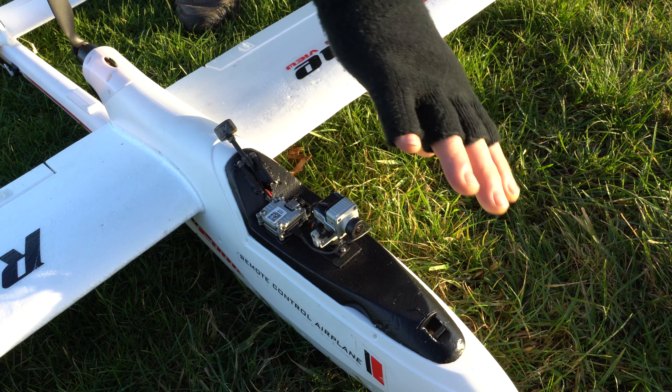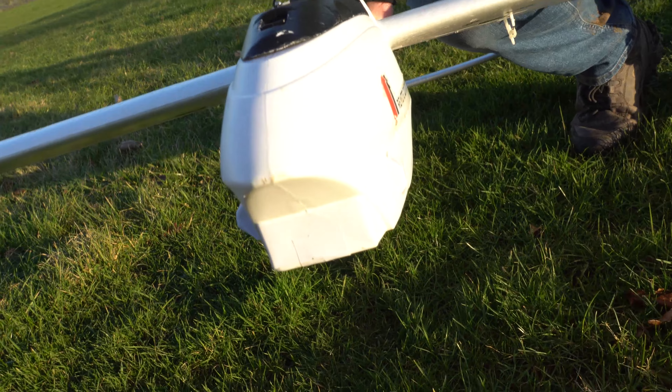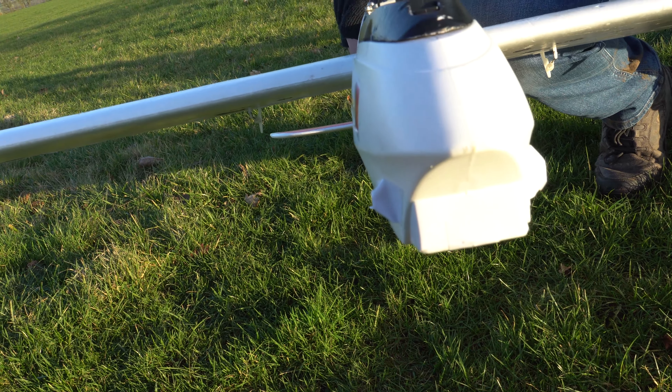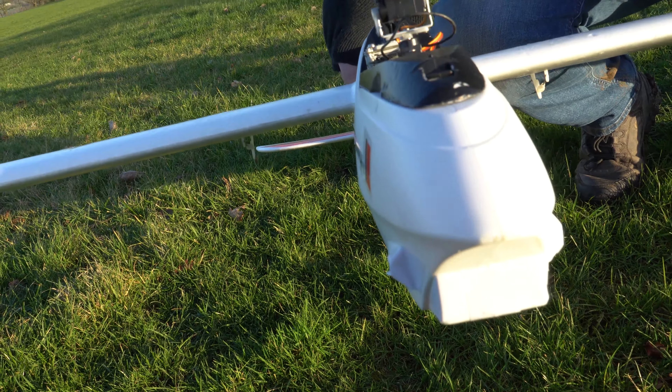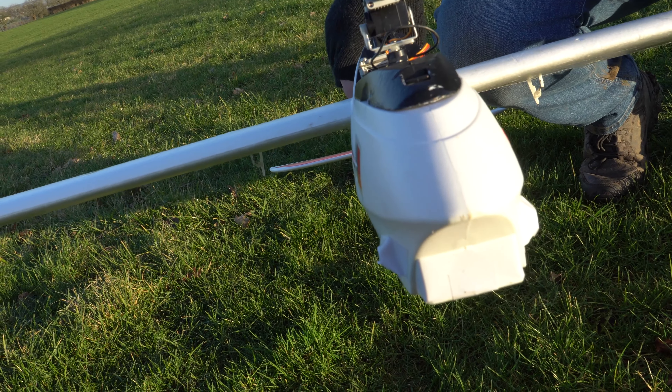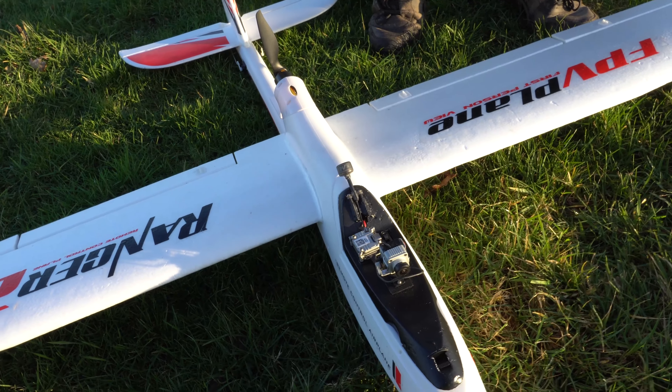I love the switch that you added so you can switch the Vista on and off so it doesn't overheat - just a bit of aggro. You sprayed this black with some Halfords acrylic paint, black satin. Black is really good for dynamic range. It had a hole in the center bottom for a small HD recorder; the two side holes are for cooling air vent airflow over the battery and the ESC. But given it's barely one or two degrees Celsius today I blocked them off to see if it made any difference to the drag.